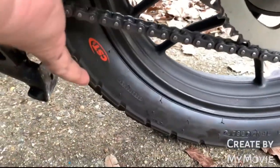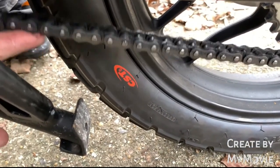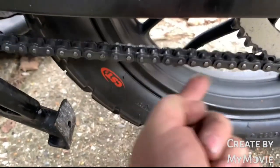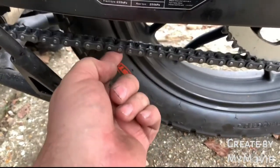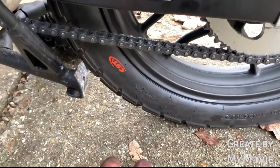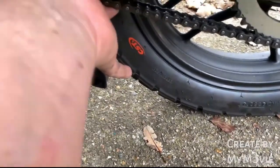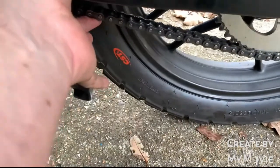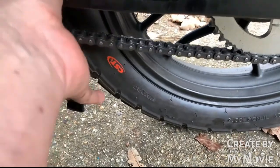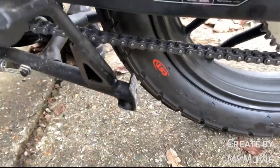Okay, and now we're looking for our 2.5 centimetres, as you can see. That's pretty much about the full deflection there. Notice how different the chain is when you've actually got weight on it than when it was with no load. Because remember, when your suspension compresses, you get to a point of tightening on the chain. So if I pull the chain there, if you watch, bounce the bike, you can see the chain very slightly compressing and tightening, and that's what you're looking at, which is why we're talking about the 2.5 centimetres when it's on load.